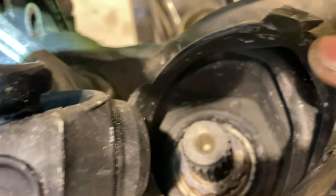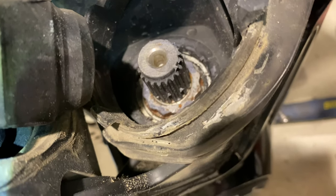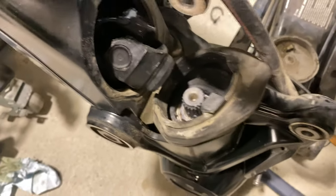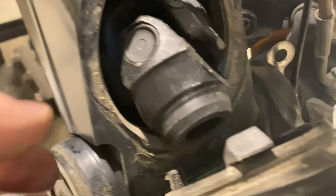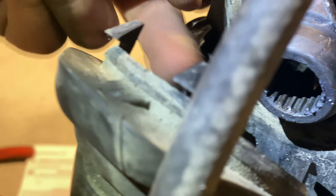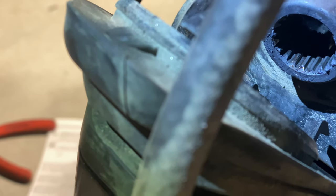There's our spline — I did molly it about 11,000 miles ago and there's still some on there. There's a little bit of rust but look how there's no corrosion at all despite about 12,000 miles on this bike. The other side of the spline looks really great actually. We're going to put our gloves back on and apply some molly lube to the drive shaft here.